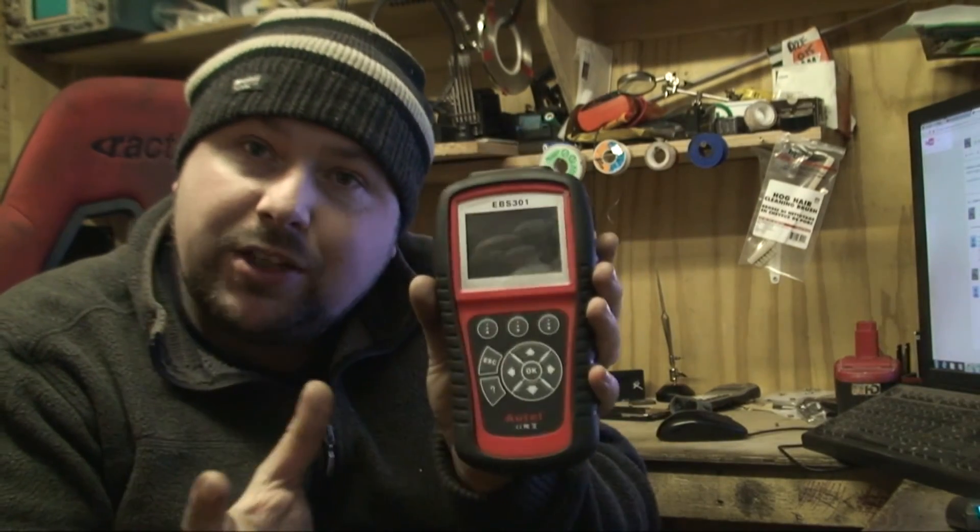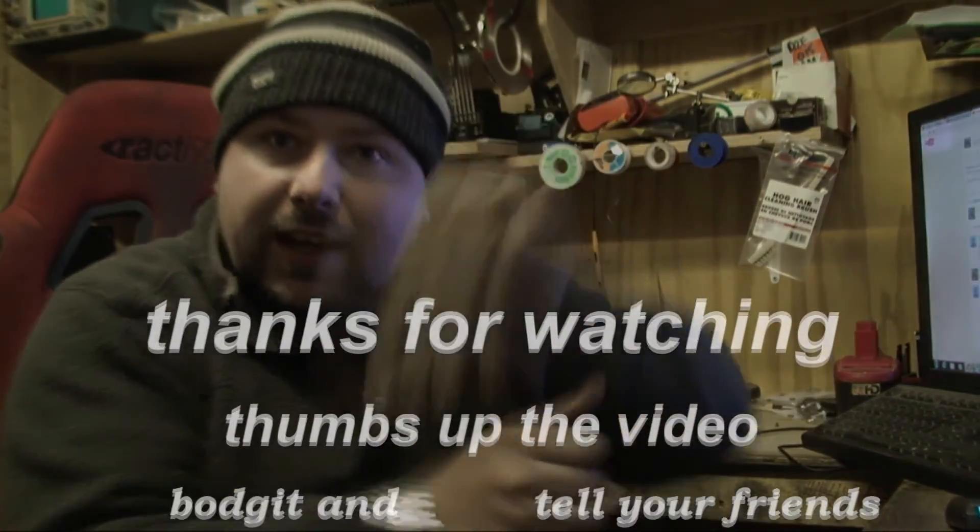So it's simple once you've got the machine to tell it to wind it forwards and backwards. But make sure — when you take the caliper out, don't press the wind forward button, because the pistons will just wind straight out of the calipers, then you need new calipers, and those calipers aren't cheap. It is really simple once you've got a little gadget — you can buy one like this, or you can buy a really cheap one; to be fair, the cheap ones are, for what they are, very good. I hope this helps — thumbs up the video, subscribe, don't forget, get your hands dirty, see you for the next one.